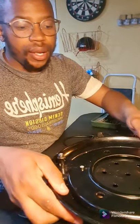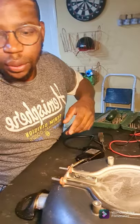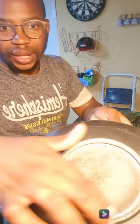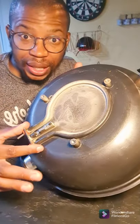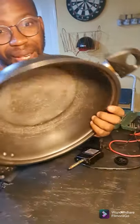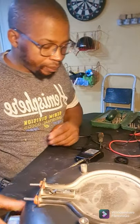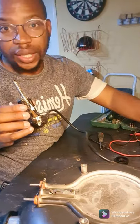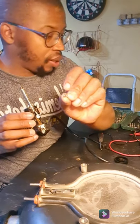I've already taken out the screws to save time. On the pan itself we have the heater element. Sadly, with this one, if we find out that the heater element is gone, the whole pan is gone — you cannot replace it because it's welded onto the pan itself. It's probably better to just buy a whole new unit. This section here needs a hex screwdriver to unscrew it.